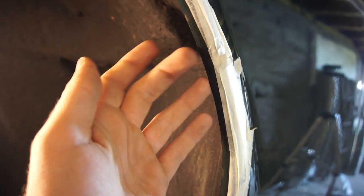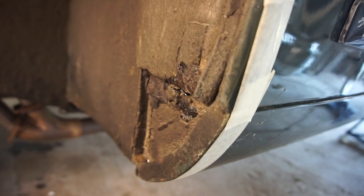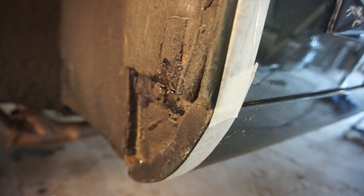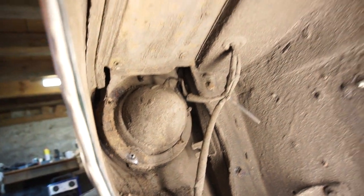Since I'm using this as a daily driver in all kinds of weather, I want the best protection possible. A common place for cars to rust is right on the edge of the wheel arch where the paint is very thin. With the wheel spinning, any spray of gravel or debris — especially in winter — will eat off the paint and start rusting there. So I've masked an area in the inner wheel arch. I've also gone a little further along here where you get a lot of road debris from the tire, especially when it's raining, so I want to rust-treat there and add a bit thicker stone chip protection on the sides.